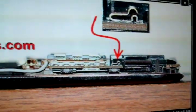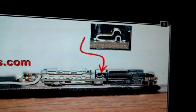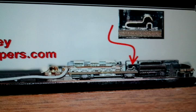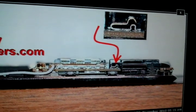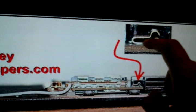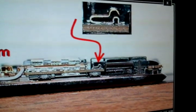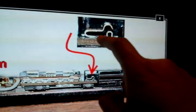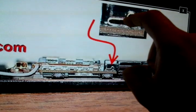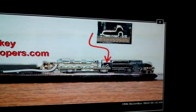Unfortunately guys, I am on my Vibrant right now and I don't have another camera, so you're going to have to take my word for it and try it. A couple words of caution: read the whole website I'm showing you, because this connection is extremely easy to break. Once you break it, you'll have the worst GPS any Vibrant owner has — because you won't have GPS at all. Please be extremely careful with that lead. However, if you're extremely careful and able to get that copper directly in there so that it props it up and you close your phone, you're going to have the GPS you've been wanting for a very long time.